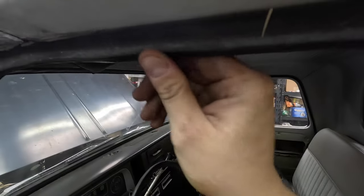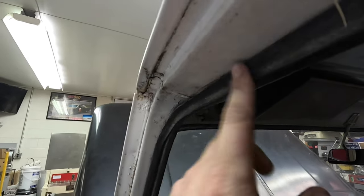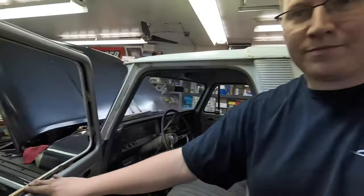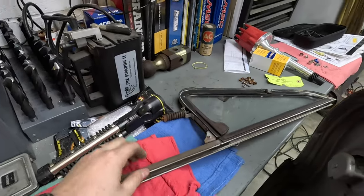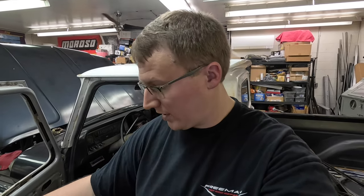You can see there's just no flex to these door seals at all — they're mashed flat, really old, been here a long time. When you drive this thing down the road, the window was basically rattling because there's no weather stripping in the channel — that's what supports the window at the front. Also, with this air conditioner you want to seal everything up to keep hot weather out for the AC and cold weather out for the new heater. That's going to make a big difference.